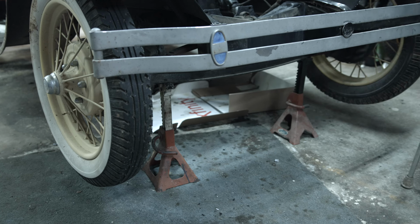And you got to remember now, these cars have been around and stored in old garages and in fields and whatever for years and years before us late model people got them out and restoring them. So the front end will have to be rebuilt. You would need new kingpins and bushings. You need new brake shoes. You need all new parts that you can get for one when you're restoring it.